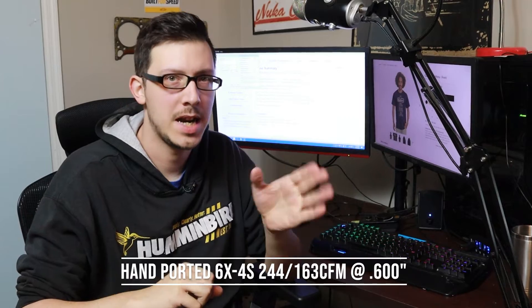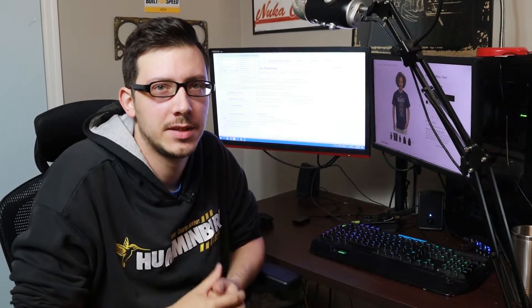The 6X4 heads range from 91 to 94 cc — we're going to use 92 cc because that's kind of the middle. For the piston dome, I've set this to minus 14 cc, which is a pretty standard Pontiac aftermarket piston. We're also using Butler's basic head gasket, a 0.045 head gasket — at least that's what it crushes down to. There are smaller head gaskets and we'll look at those later.